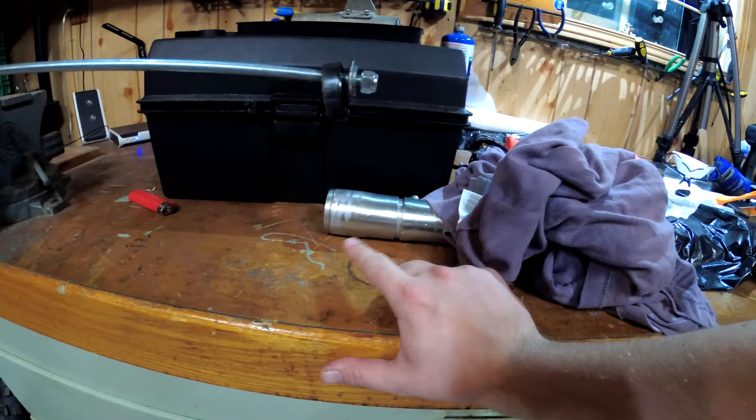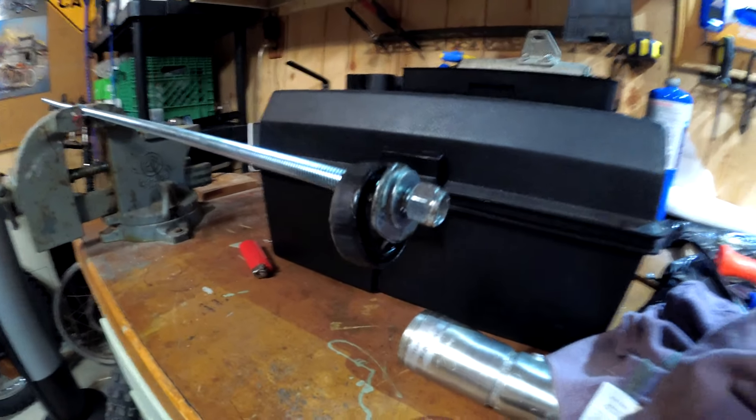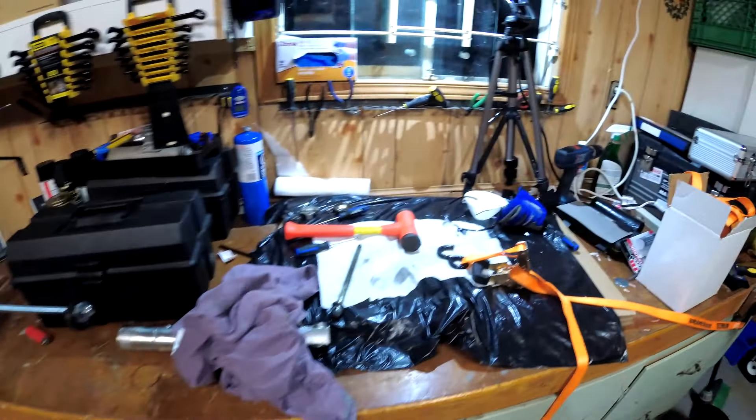I'm not sure what to do. I basically created a puller type deal — a threaded rod with some washers and a toe strap. I had the toe strap hooked through here, one end on the other vise, really tight, and it still wasn't going. The seal wasn't coming out. I was tapping at it with a hammer, so it's getting pretty ridiculous. It's the next day. I got really sick of trying to get this seal out. I talked to some wise people in the Yamaha Enduros forums and they reinforced my idea that I need to use heat to get the seal out. I did use heat, and I did get the seal out. I heated up the fork lower and used my washer puller to get the seal out.